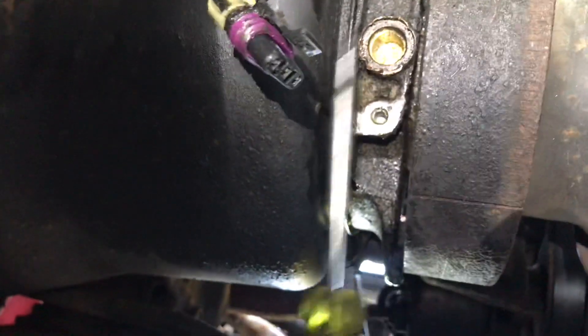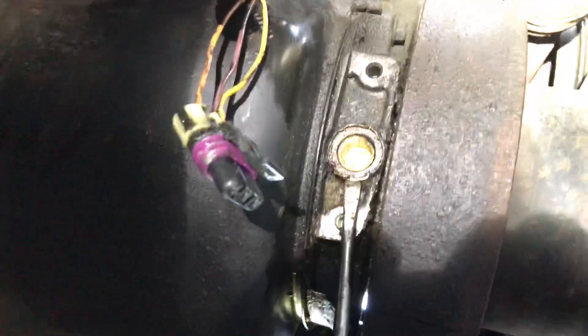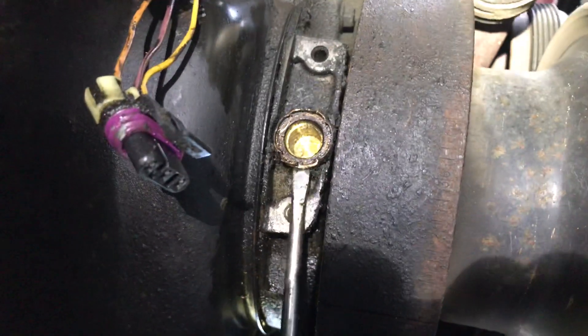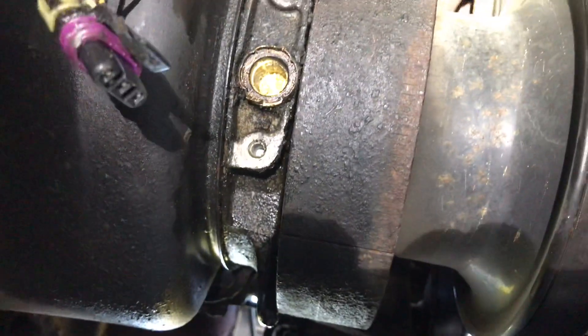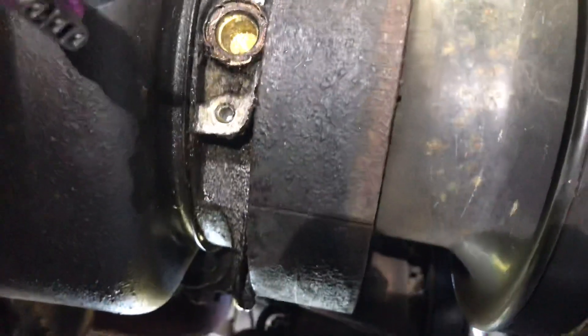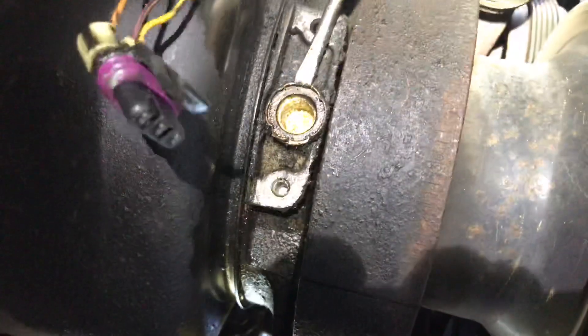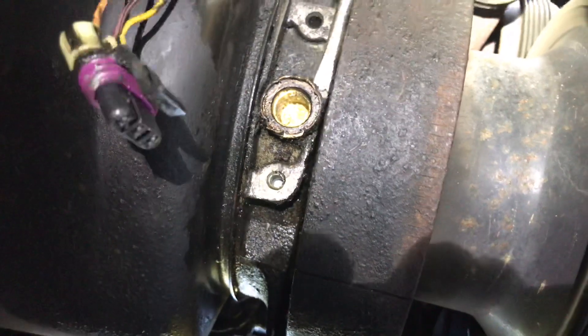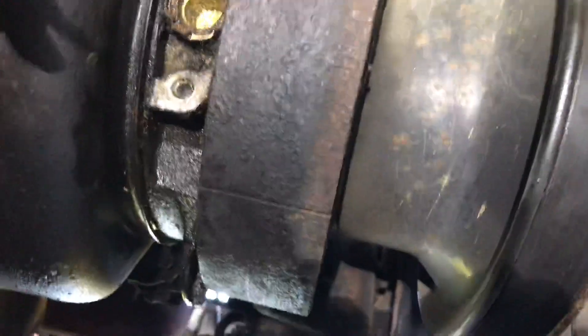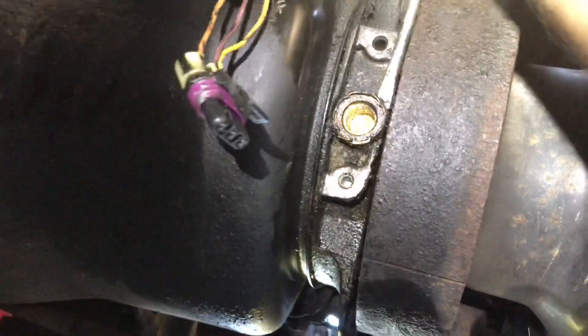What you want to do is wait for your engine to be cool, and then right behind the crank sensor like this, you'll start prying nice and easy. Then you go on top, keep twisting, keep shaking, keep twisting nice and easy. Don't panic, boys or girls. You got one flat head screwdriver and you keep working it out like this, nice and easy.